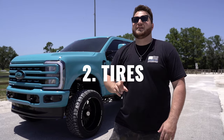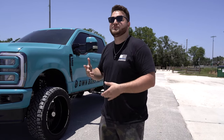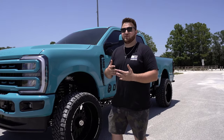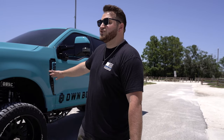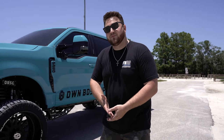The second mod — if you're using a pickup truck, you're probably taking it on a job site or off-road to the mountains, camping, whatever you're doing. The stock tires that come on your new truck, or the truck you bought on Facebook, are probably not the best. I recommend you get a brand new set of tires — a mud terrain or all terrain depending on what you're doing. I wouldn't recommend mud terrains unless you're going for a show truck. All terrains do great in the mud. If you're taking a three-quarter or one-ton truck into the mud, you're not going to do well anyway, so you might as well get an all terrain for the best of both worlds.